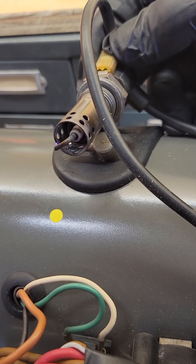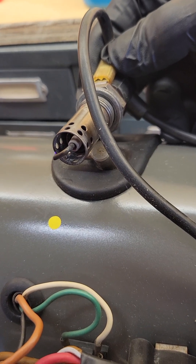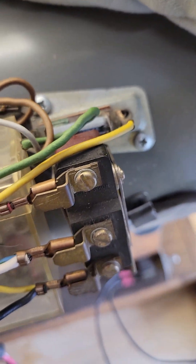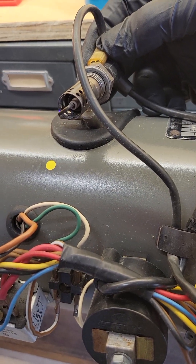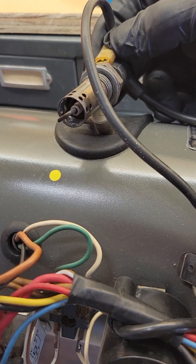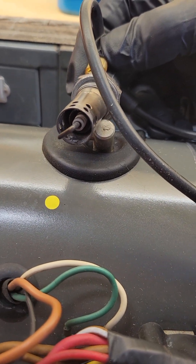The glow plug goes out. What happens is, once the gas ignites in the combustion chamber, it triggers a quartz rod in this black box right here. The metal expands in the heating chamber and it shuts off the glow plug.